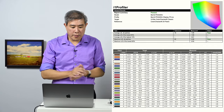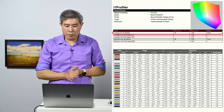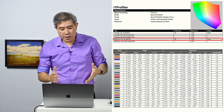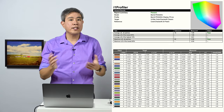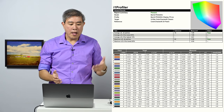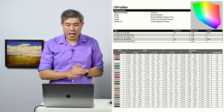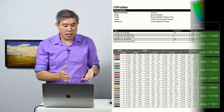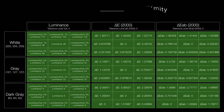Let's first start with DisplayP3. In DisplayP3, the average DeltaE across all patches is 1.9, with the maximum DeltaE being 4.96 — a little on the high side, but it still passes our standard of any DeltaE below 5 being considered a good display. Considering the average is below 2, this is a fantastic result and a great color mode for calibration. Additionally, DisplayP3 provides greater color uniformity across the panel because BenQ calibrated it specifically for higher uniformity.